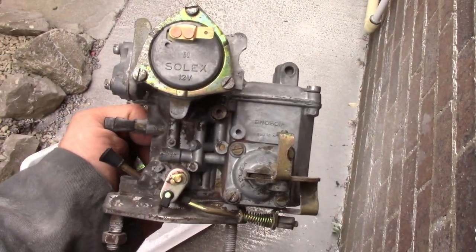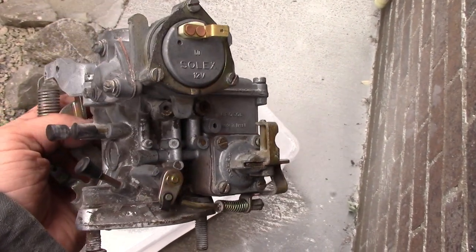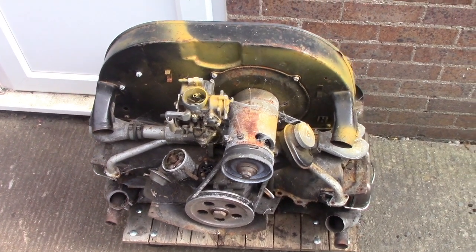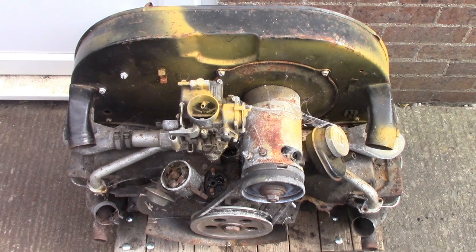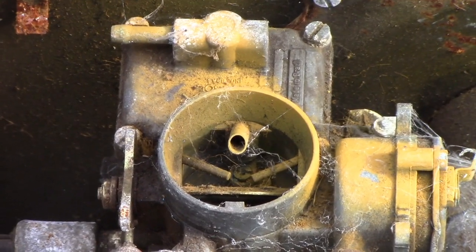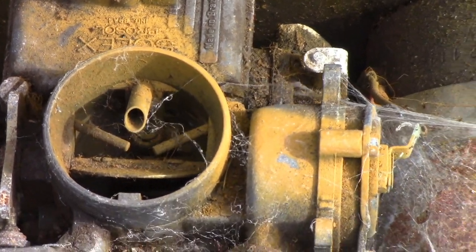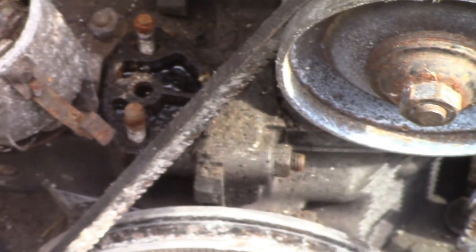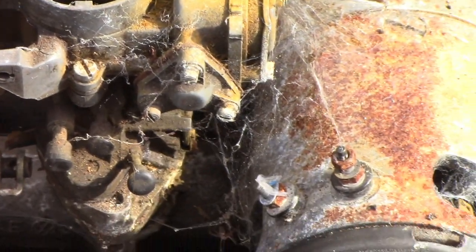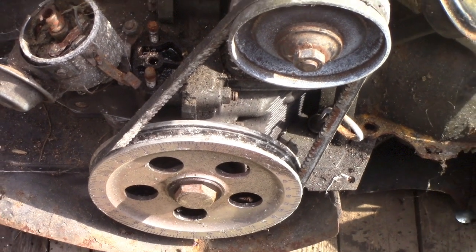I think maybe the other method with the homemade blaster for little areas like this might be the way forward — but for something a little bit more, like paint removal off tinware. Looking back at the engine, you can see the sort of state it was in, and the carb was in a particularly gruesome state. A quick blast with a £20 home-brewed soda blaster did the job. If I was to do it again, I'll split it up into the various parts and blast those separately — I think it will do a really good job. I'd also use the blaster on things like pulleys, maybe the distributor, maybe manifolds — I think it's great for things like that. At £20 it's a no-brainer. The larger areas of the car I'd take to a professional and let them do it, for the sake of the mess it creates. But it's well worth doing.